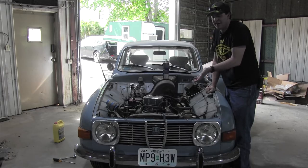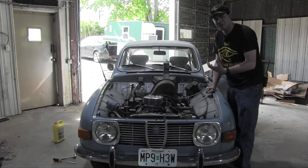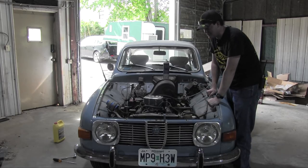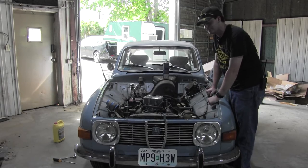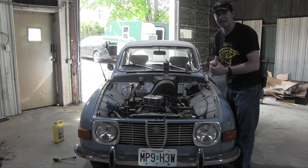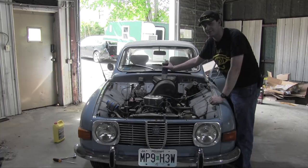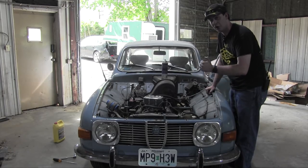When I make anything from scratch, especially anything with this low build quality, I expect to have problems. The only thing that upsets me about this is the knowledge that I'm going to have to take off the carburetor again using those incredibly difficult to access carburetor nuts. And that thought is slightly upsetting. So what I'm going to have to do is take the carburetor off and either fix or make a new carburetor base plate, because this one is ripe with vacuum leaks. It wouldn't even run unless I choke it all the way.